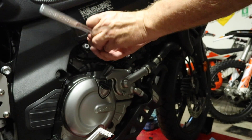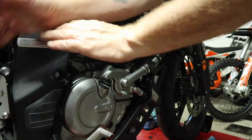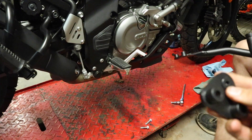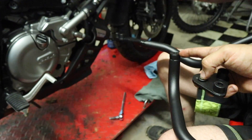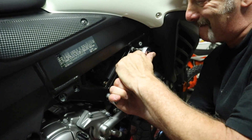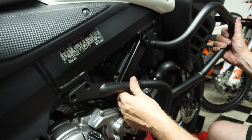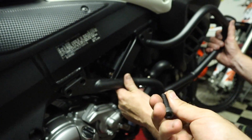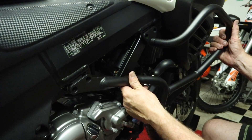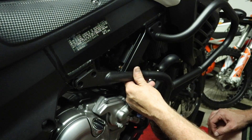We're starting on the right-hand side of the bike. We've got a 6mm hex and we're going to go ahead and pull these two bolts out. With those two bolts removed, we're going to move on to the crash bar. We've got this little piece, and you grab your flathead screw — it just seats down in there — and we're going to mount it right here. We are going to put a little Loctite on there. We're also going to take these front two bolts off. This is the little piece we added with a 5mm screw. We are not going to reuse the factory bolts — we're going to use these longer bolts that GV included. Do not remove bolts from both sides at once because that's helping hold the engine in. Just work one side at a time. We'll get these bolts in, put a little Loctite on them, get them locked down, and move on.